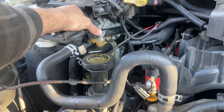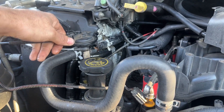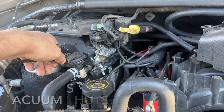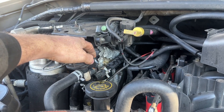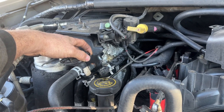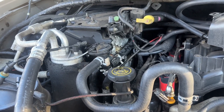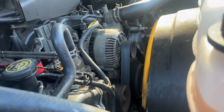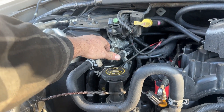It's getting blown - look at that - we're not getting a whole lot out of it. Let's see if putting it back stops it. Okay, that stops the vacuum when it's capped. This thing shouldn't be pushing water much - it's running but there's no water circulating through that. So it probably has a weak water pump.